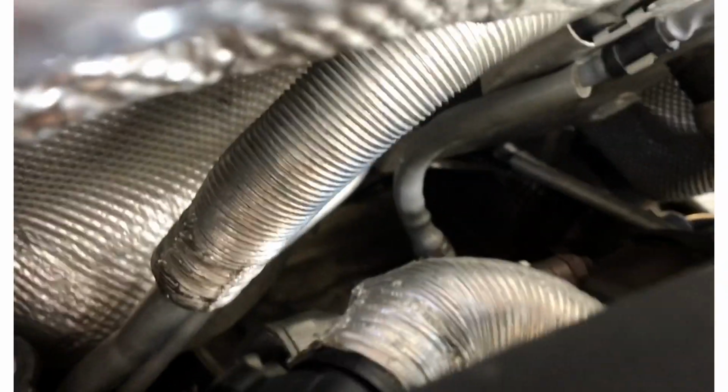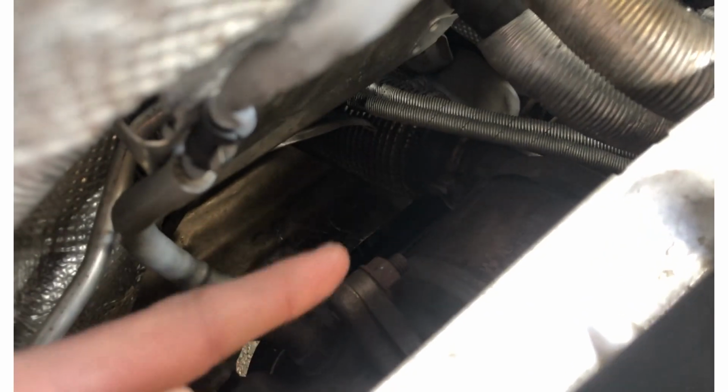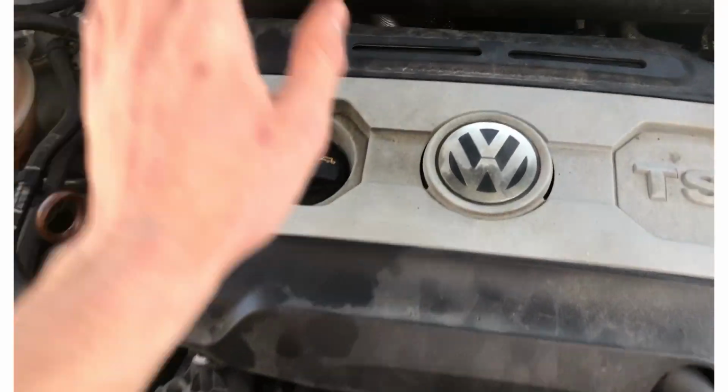Like I said before, we're running on three holes right now on this lovely 2-liter engine. And I think the problem child is right down here. That's the wideband right there sticking out of the side of the turbo. This is the CBFA engine, the California compliant one with the primary gigantic cat coming right off the turbo because apparently it's better for the environment. But yeah, we're going to go ahead and get these installed.